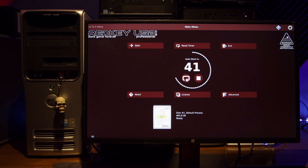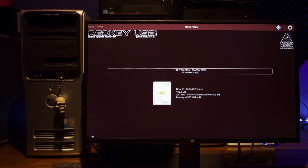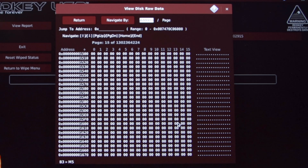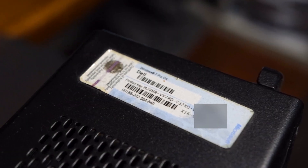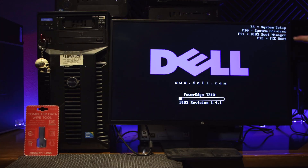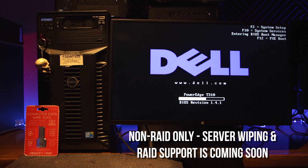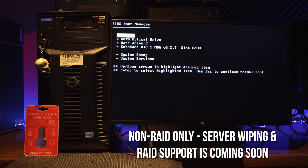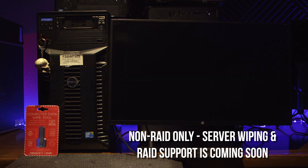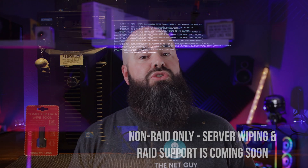The first thing that comes up is a custom wiping screen and menu. Within minutes the data on the computer is successfully wiped out, and even a sector-by-sector hex editor and recovery tool can't see a thing on this machine when we're done. One pre-warning: if your computer OS is very old, you may want to back up your Windows key for Windows 7 or 8, Windows Server, or any non-digitally licensed OS, just in case you want to reinstall after the wipe. Next up is an old Windows 2012 server — a Dell PowerEdge, a really common model for small businesses used for email and sensitive file storage before switching to the cloud. The wiping process is exactly the same: override the boot sequence, tell it to launch from the USB key, and within a few minutes the job is done and the server is rendered inoperative.